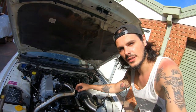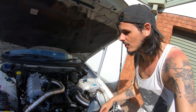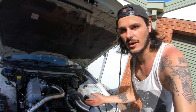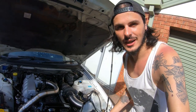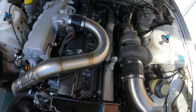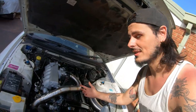I've got to chuck in the coil packs and I've got a new coil pack harness as well so it's going to look fresh. Pretty much this is a full fresh build from the ground up — got it all acid bathed and cleaned. The pistons are 86.5mm so they had to re-bore it 0.5mm to fit. I can't wait to see how this thing handles and sounds performance-wise. I'm just happy to have the car back with the fabrication done, and Bevan just killed it — I'm loving these welds.